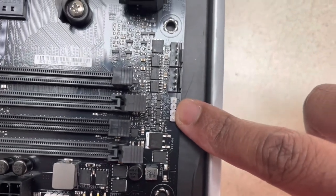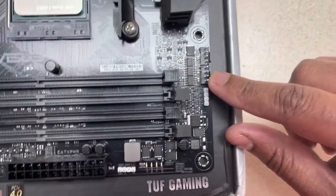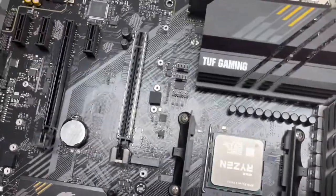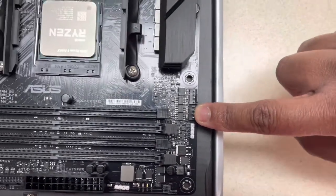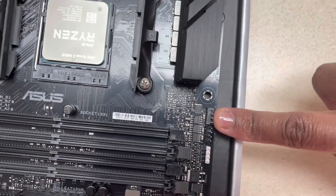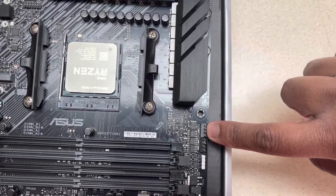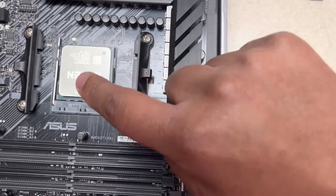Here's another addressable header if you want LED strips coming out the top. This is your CPU fan header and this is your CPU_OPT header. If you have an AIO, don't hook the pump up to CPU_OPT — there's a dedicated AIO pump header on the board which I'll show you in a second. Leave CPU_OPT for the radiator fans connected to your AIO. You want the radiator fans connected here at CPU_FAN so they spin based on CPU heat. Connect your AIO pump to the dedicated AIO pump header — don't connect it to CPU_FAN or CPU_OPT.